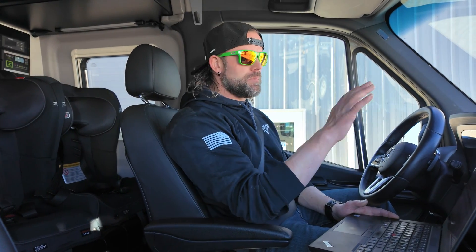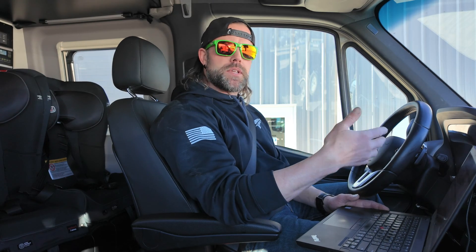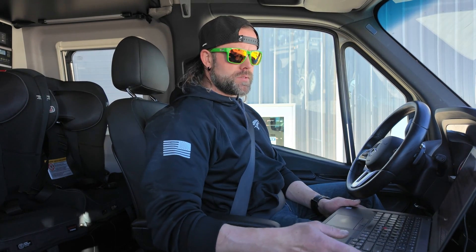The active brake assist, adaptive cruise control, and many of the safety features in the vehicle are all tied to that front radar sensor. Just because you get that warning on the dash doesn't mean it's the sensor — it could be a multitude of other things. It's a very complex system with a lot of wires, sensors, and modules. But the most common cause is misalignment of that front sensor — it got bumped and moved, or a wheel speed sensor became disconnected, or a wire got pinched.